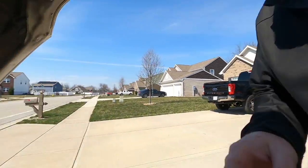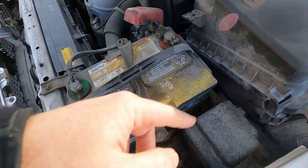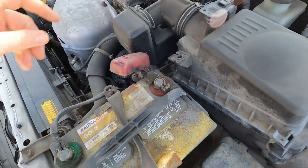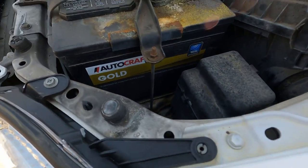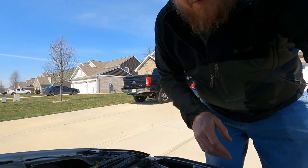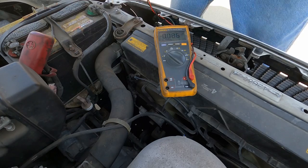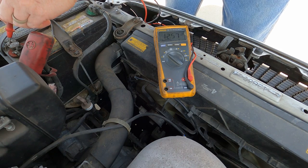Now that we're under the hood, we've got the battery. It looks like a fairly old battery. He's got a lot of corroding here. Terminals are tight. The corrosion shouldn't be that big of a deal, but it could be a fairly old battery. It's a five-year-old battery. Let's grab the multimeter and check this battery out. Hopefully you can see that at rest, this battery is getting 12 and a half volts. That is good.